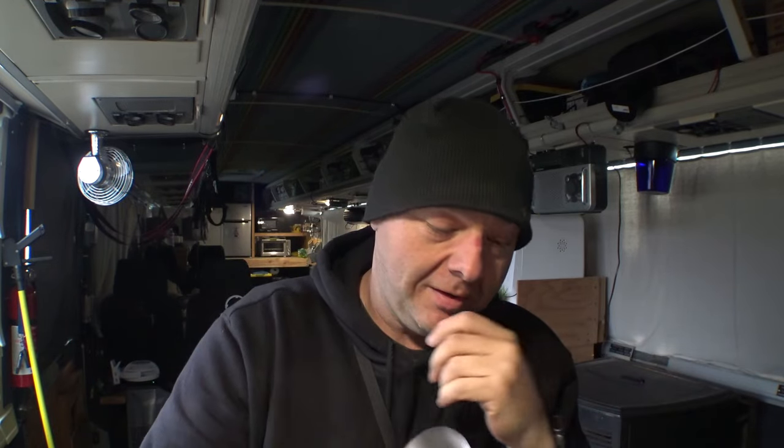The thought is I'd like to see if I can get a hold of another set of the Volt Pro batteries and set this up on a test bench, because it'd be a lot easier to connect a load to the batteries, run them down, charge them, and do several cycles. Even though chargers are programmed to do a certain thing under certain conditions, the voltages may not be exactly accurate. For example, if I'm just guessing, if this thing charges to 29.8 volts, it may actually go into absorption mode before or after that. So it's going to take a number of charging cycles and data logging to figure this out.